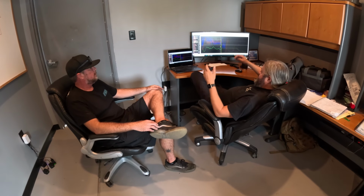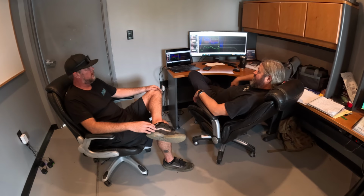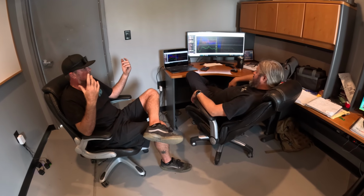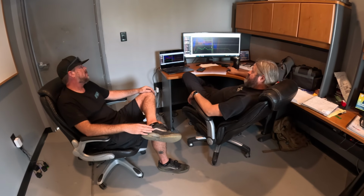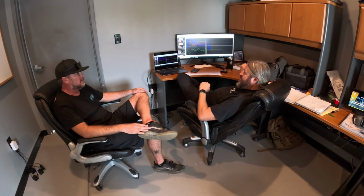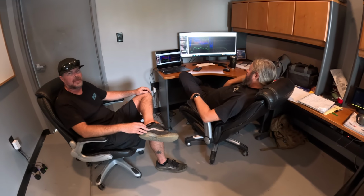Okay. Well, let's just change headers and just see what that does, one way or the other. And we could run those no bullhorns and put the bullhorns on and see what happens, back to back. And there's a good chance that it may want to be considerably leaner than it is right now. So we got more to play with. But I would be curious just A to B, what do the headers do? Okay. So leave the tune alone, change the headers. Right. I love this part. All right, let's go grab some hot headers.